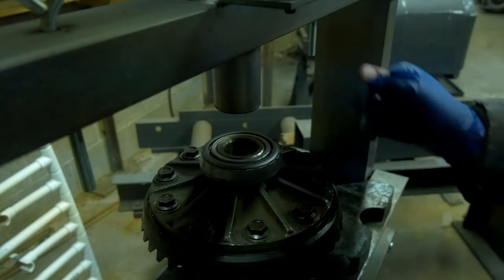You do want to put a little bit of grease on the lips of the actual seal, as well as the flange where that seal rides, mainly to prevent you ripping or tearing or causing any potential leaks on this brand new seal. So like I say, take the time, Scotch-Brite where that seal rides, and then just apply a little bit of, I got some moly EP grease. It doesn't really matter what kind of grease you use here, just a little bit of grease to aid with the installation. And so we're going to lube both the pinion flange, as you can see where that bearing rides. I've already Scotch-Brited. I just use a little gray Scotch-Brite pad. You can get away with a maroon one if that's all you got.